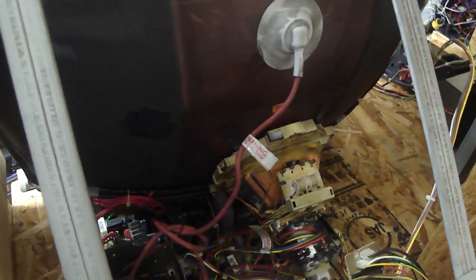Disconnect the grounding wire from the frame. When you put the anode cap back on, make sure the suction cup is up so you can see it's getting a proper connection. Get both clips in — one clip, then the other. Now the two clips are in and you can lay your suction cup back down. That's how you discharge the monitor, how you switch around these wires, and how I corrected the video problem. Now I can use the Gumbelina board without a glass mirror — just pull out the guns and it's ready to go.